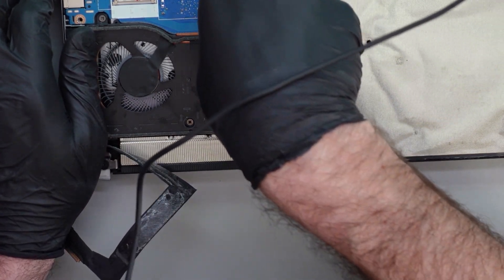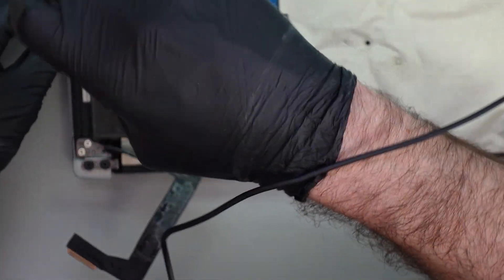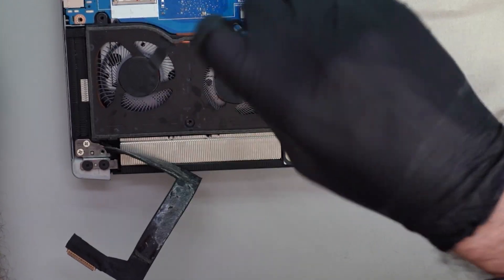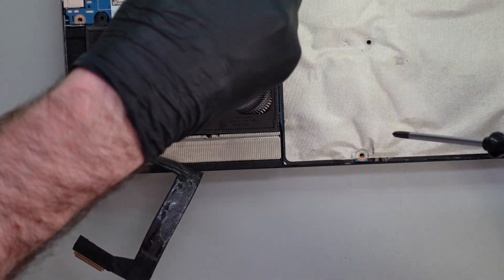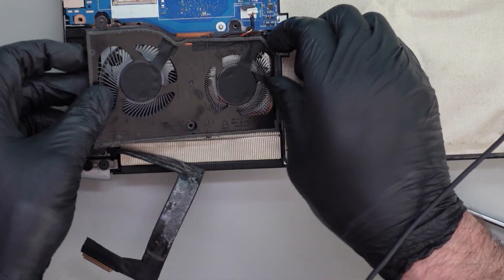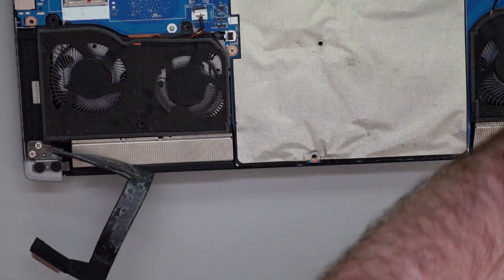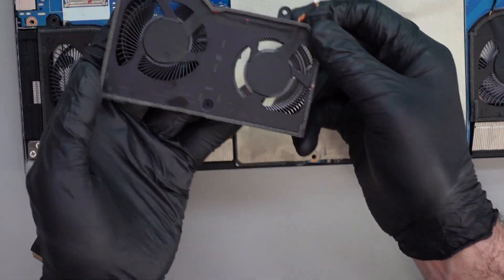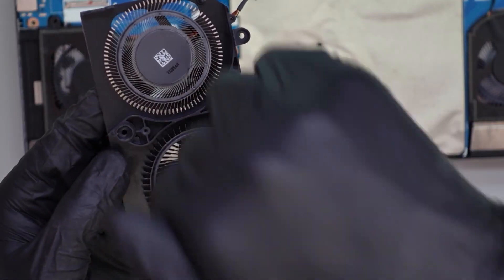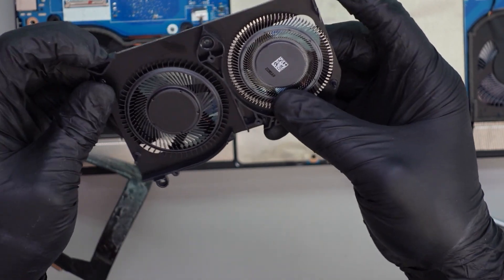I think I know what's going on here. Let's take out the fan connection and pop some screws. See, this is even lifted — it's not totally flat, so this is not good and this is dangerous. That's probably why it's in here for repair, and it looks like a repair has been attempted before. If I lift this up — see how bad this is? This part is actually broken here. The reason it's broken: I have the new replacement fan here, and we can see it has three screws, but it looks like on the other side there are supposed to be more screws going through the board, with little latches that hold it on.